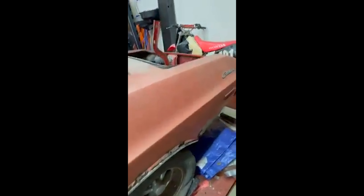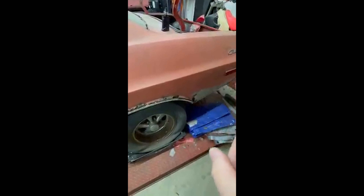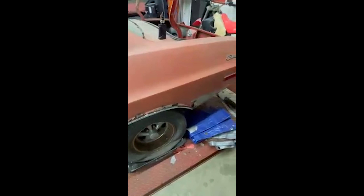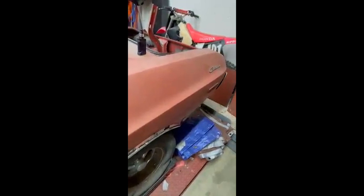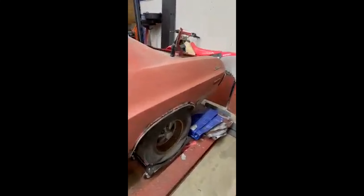Wherever the gas tank bolts up is where you get a lot of water just laying in there. We got a new trunk pan — a one-piece, which you can't put on unless you take the quarters off. So we got new quarter panels. From what I understand the car was parked partly because of carburetor issues and partly because he wanted to put new quarter panels on — so it is finally going to get those new quarter panels. There's not going to be much stock metal left on this car, and I know I'll catch some flak for that, but my goal is that this car lasts another 50 years — so that somebody else can enjoy it after I'm dead and gone.